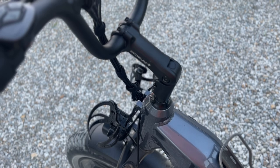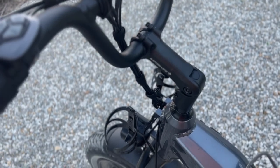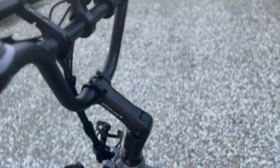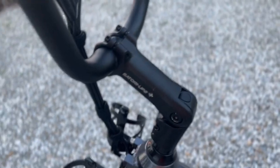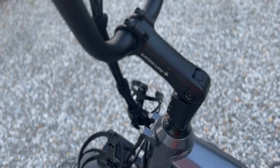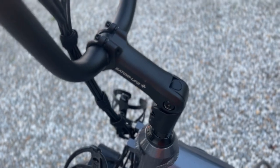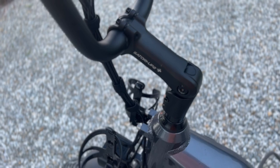If you're 6'3" like me and your torso is longer than your legs, while the seat height to the pedals is fine, the stem on the handlebars was not. So I went on a hunt for a stem extension that would allow me to push it a little further forward because I've got really long arms. I found this one from Satori — this one is specifically e-bike rated. A lot of people put stem extensions on e-bikes but they're just cheap aluminum. I'd encourage you to invest — it's twice as much, maybe 30 to 40 dollars versus 15, but get one that's actually rated for an e-bike.